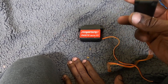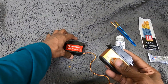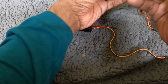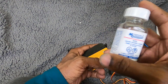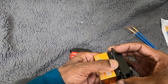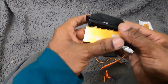If you have an Amazon Prime account, the JX servo is 45 bucks right now. I've run this thing in literally all of my one-fifth scale cars — it's after two Arrma trucks that I bought these for. Neither of these servos are waterproof. When you crack them open they do have a seal that runs around them, and I've already been working on it since it has a coating on it. I've already put a coating of conformal coating on it, which is more or less a must for these servos if you want them to last, because water gets in them.